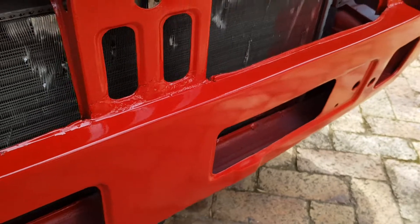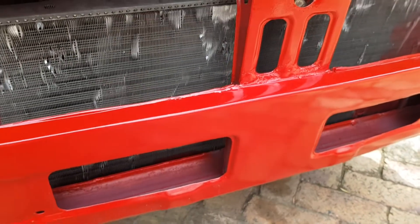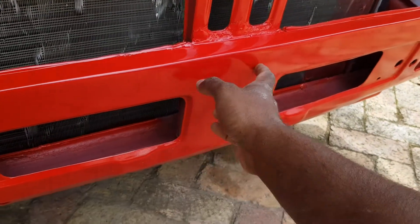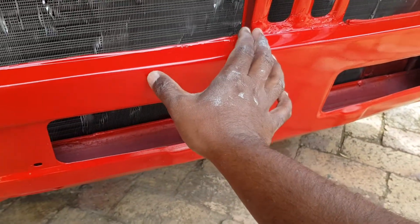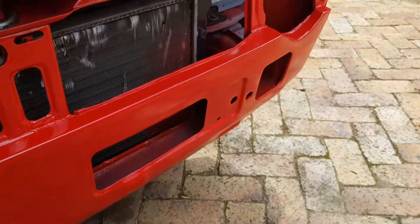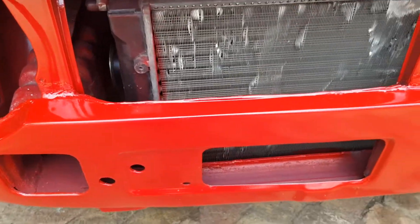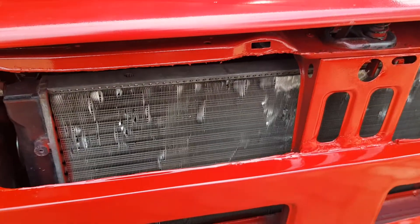Please make sure you use enough fiberglass — I used about four layers so it's absolutely strong. I then ground the cradle down slightly where it joined and mounted the fiberglass onto the metal. I filed it and painted it, and as you can see it actually fits on snugly.